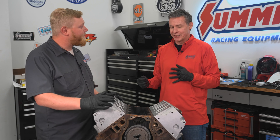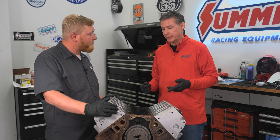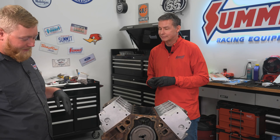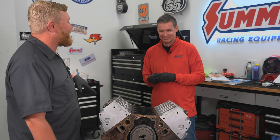It's kind of funny — we're taking this engine that was kind of pedestrian, but in a lot of ways we're building it up like you would a Trailblazer SS LS2 engine. That thing had 10.9 to 1 compression from the factory, and we're putting a Torquinator cam in it on top of that. So imagine all the power of a cammed-up TBSS in this Ford. Let's get a front cover and a fancy balancer to put on this thing — this is when all the cool trick parts start going on.